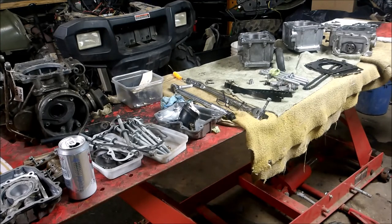I hope this helps you out. Keep an eye on the gaskets, what kind you buy, make sure you have clean surfaces, and make sure your torque sequence is correct. I have a video on how to torque a head down the proper way for Polaris. If you like the video hit the thumbs up and please subscribe to my channel — I've got plenty of Polaris repairs on there, anything from two-strokes to four-strokes. Hope you enjoyed the video, and like always, till next time.